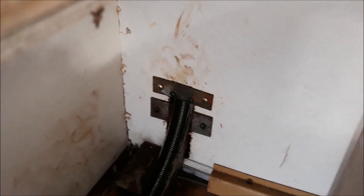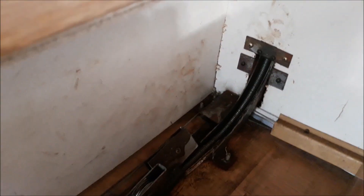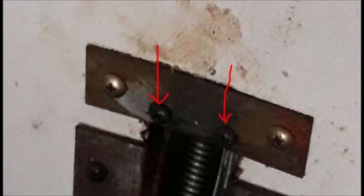What you'd do is come into the van, go to the respective corner, and make room by clearing the access panels. For the purposes of this video I'll show you the front. There is a bracket at each corner, as you can see there, with four screws in it. The outside screws fix the bracket to the van, and there are two black screws on the internal part of that bracket — those are what hold the lifter arm to the caravan. So it's a matter of undoing the two black internal screws and then pulling that lifter arm out and freeing it.